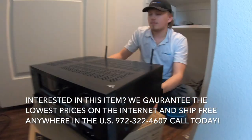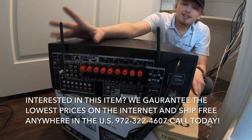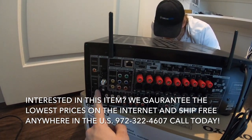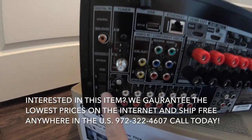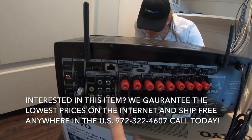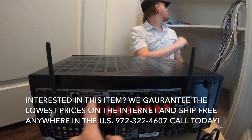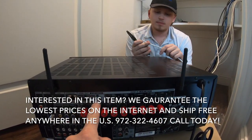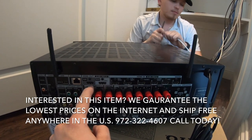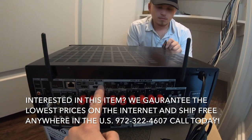Let's see the back. Got some Bluetooth and Wi-Fi antennas, digital audio inputs — coaxial as well as optical — AM and FM antennas, video component, a powered USB, and an internet input to hardwire it. HDMI inputs one through six, plus a main ARC port for audio return, and a sub output. This amplifier supports 4K HDR HDCP 2.2, which is your most current version of HDMI — important if you're passing true 4K content.